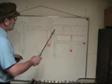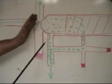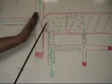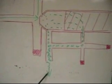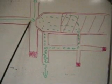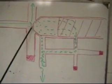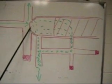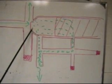The oil comes up here against the oil pressure relief valve, and the faster the engine goes, the more pressure there is coming up against here. Well, this valve opens up and relieves some of the pressure, and the oil drops back into the sump through a line here. We'll show you on the block itself. And then the remaining oil goes up out the back of the block and into the oil filter. But this valve is critical to keep the pressure from getting too high.